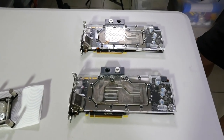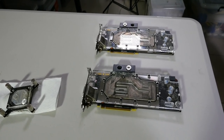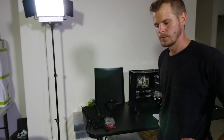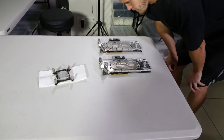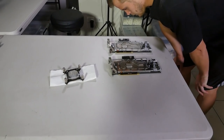As I was saying, galvanic corrosion — we have a lot of different metals here and these metals are not that far apart. Check out the galvanic corrosion chart so that you know how pure and impure metals are and how far apart they are. The further apart they are, the more likely galvanic corrosion is to occur. The closer they are, the less likely it is. But if you don't have corrosion inhibitors in your loop and you're not using a high quality coolant, then the chances of corrosion are very, very high.